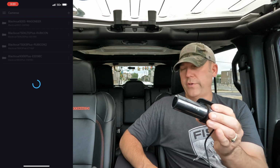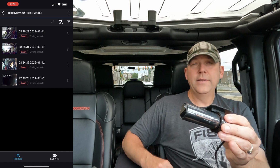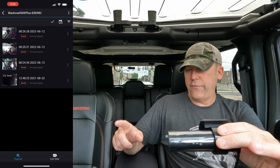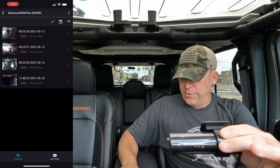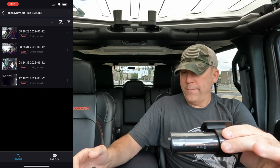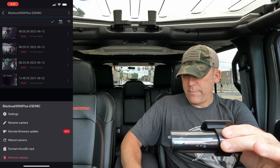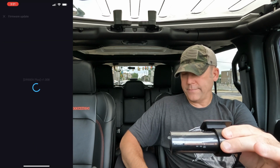You may run into some issues like this your first time, so I want to show you how to troubleshoot this. There we go. We're connected to the camera. It's going right into the actual video files that it's already connected. So we want to go to the top right-hand corner with the three little dots and click on that. Then you see where it says Remote Firmware Update, and it says New. Press that.